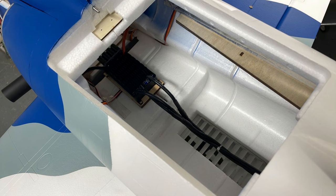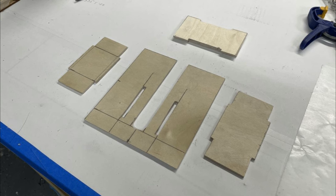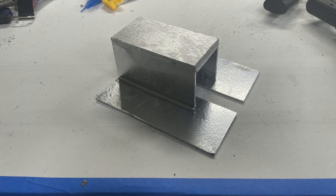Here's the ESC. I actually got an email saying you have to mount this over the cheater hole or it's going to catch on fire. Give me a break — there's no way they're selling this kit if it's that bad. But out of paranoia, I decided to build a box to elevate the ESC to get it more into the flow of air. Mounting it down low, I think, would be problematic.